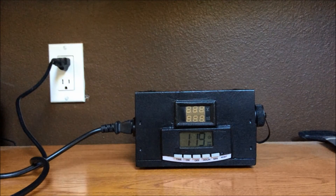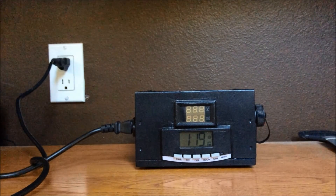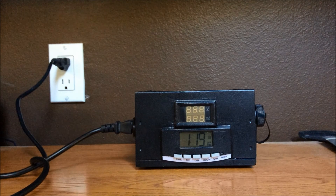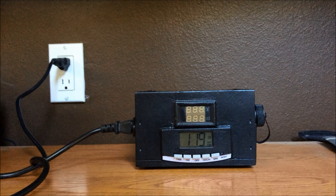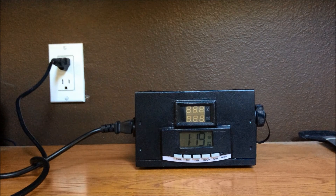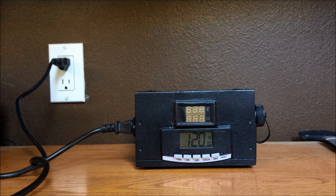If you have any questions as to how long you should charge your hybrid battery and want to talk to us about the condition of your battery pack and some of the symptoms you have — because there are many reasons why people buy these chargers. It could be to maintain a good battery, or to try to rejuvenate a battery that's given IMA error codes. Depending on your situation, everyone is going to have a different initial soak charge and subsequent charging after that, and a different schedule for how long and how frequently they charge.